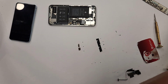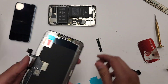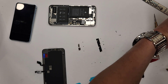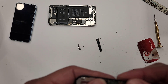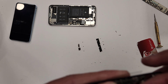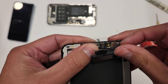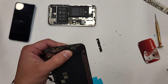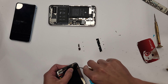Then I get the new iPhone XS Max screen and take off the little wrappers. I notice that little plastic piece — usually when you get a new screen it's already glued on, but this one wasn't. That's fine; just stick it in place and work in reverse. Basically, I connect the ear speaker to the little slots of the plastic piece at the top of the screen and work in reverse. I get my three screws and screw them right back in.